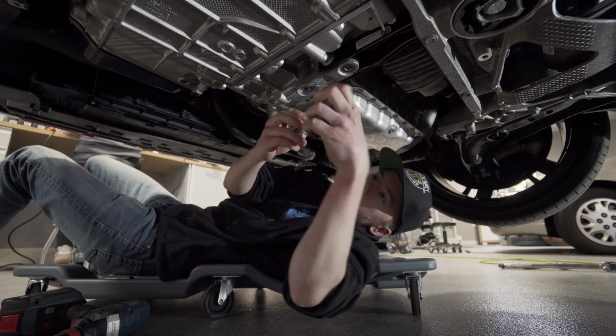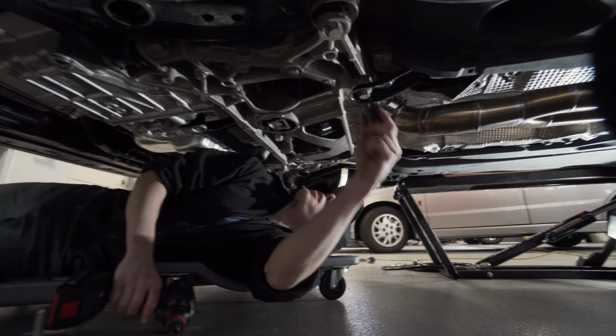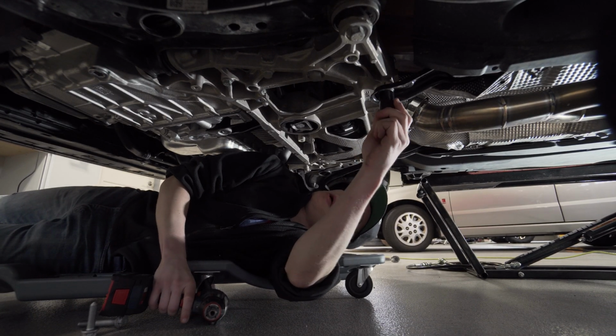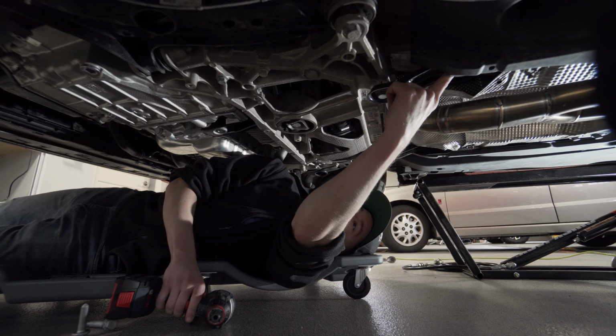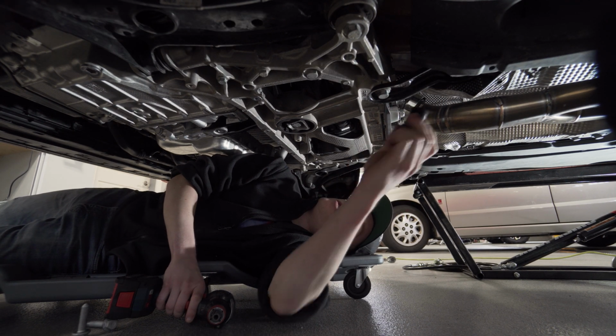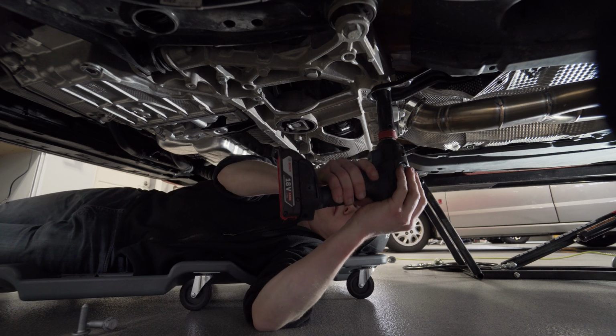Remove the bolts securing the steel subframe brackets to the subframe and body. These guys. Yep, so it might be 2 16s and an 18, is that what it is? Or is it all 18s? We gotta get this off too? That's what it says, take all 4 off and set it aside. Those are probably 16s? Yeah, but how are we gonna get at that?